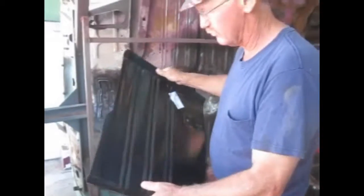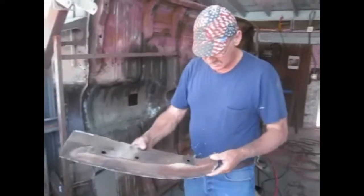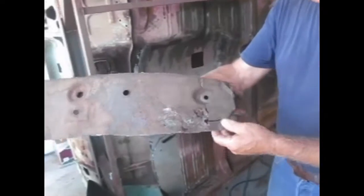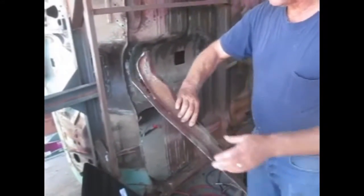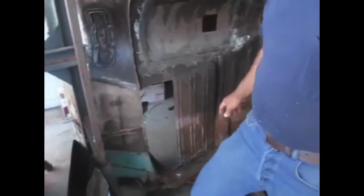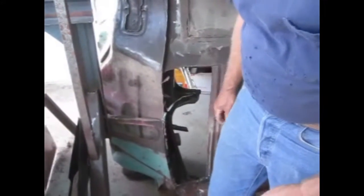It looks like it's powder coated, but I'm sure it's a weld primer on it. The front brace is involved in this removal process. The kick panel retainer is part of the floor — I'd probably make another one of these out of a piece of 16-gauge steel. This one's pretty pitted, but if I wanted to save it, I could probably save it. Where the brace is attached to the rocker, it's spot welds — I'll remove that and begin the process of cutting and chiseling them away around the spot welds, then grind the rest of the steel off — same thing along the rocker.